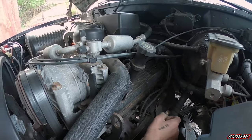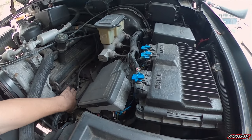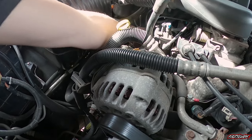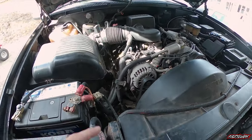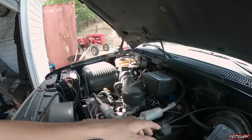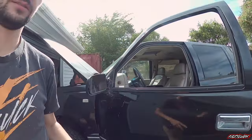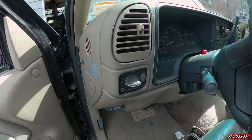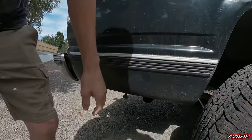I'm assuming or hoping it's the same cylinder every time. It's hot already — I don't think it's going to be that cylinder. You can feel it's warm-ish. Maybe one of those middle cylinders isn't quite as hot. So I just pulled it off at the dizzy, do cylinder one first, and I'll go through. Sounds about the same.